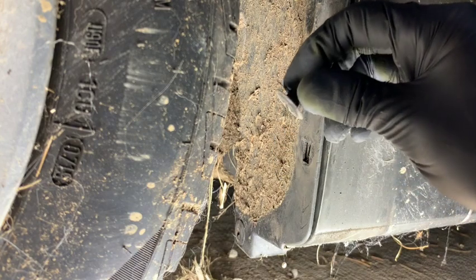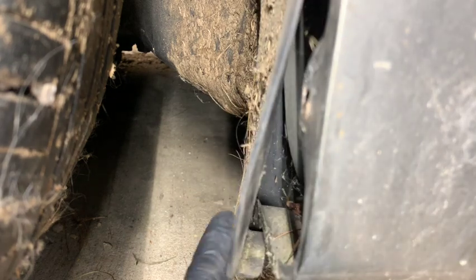On that one we actually saved the tabs but they're still kind of pushed in, so I'll probably still replace it. The bottom clip on the fender is nearly impossible to show because it's so tight in there. The fender rolls down and clips below the lip. You basically have to look over the top of where the fender rolls down, look for the tabs, figure out which way they're arranged, and use the flathead or pick tool while putting pressure out. You get the general idea from the other two clips.